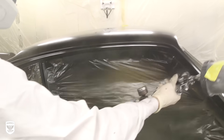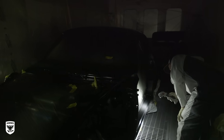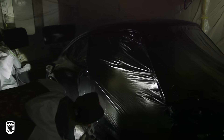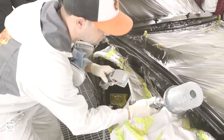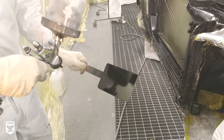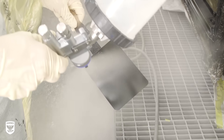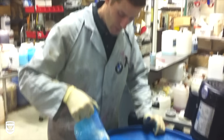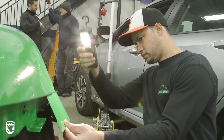This last layer was added for safety — making sure all parts from every angle are equally painted is important. Then the guys shut off all overhead lights and used a powerful paint light to reveal areas of the frame not evenly covered. This requires a very good eye to discern slight differences in pigment hues. Notice also the square piece of metal on a wooden stick — this test board represents my car. During each stage of the painting process, Lurvin would spray the same paint onto this test board. From a manufacturing perspective, this is called batch retention, to ensure every batch is exactly the same.